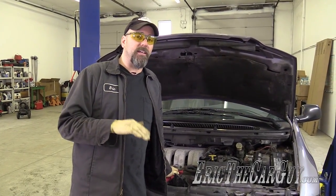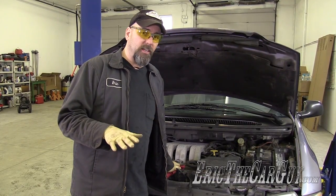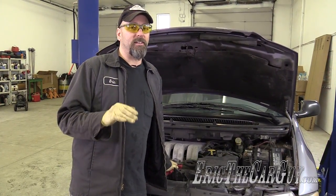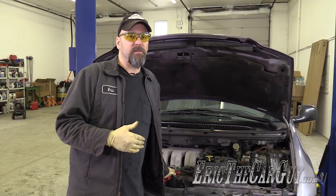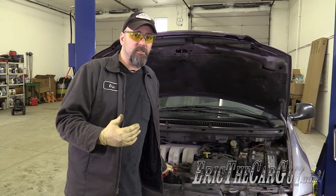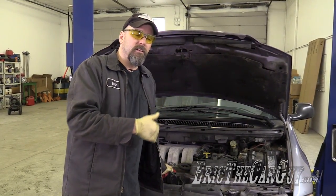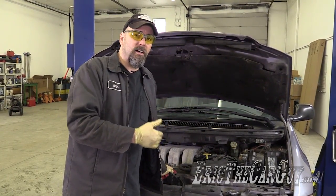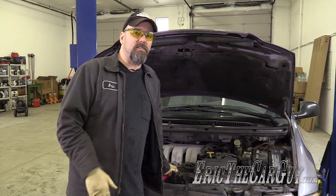Now if this does work and this is the issue, what I'll do is look for leaks because that transmission fluid went somewhere. So we're going to look around, see if we can find the cause of the low transmission fluid. Once we've done that and repaired it, probably what I'll do is do a transmission fluid filter change just so that I'm sure that any clutch material or anything like that — that may have been created as a result of this not working like it should — is cleaned out, to give it the best advantages I can so that the transmission doesn't fail down the road.